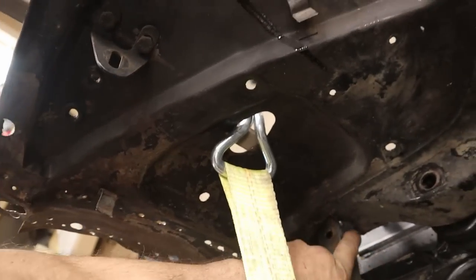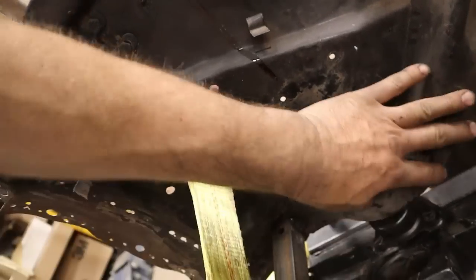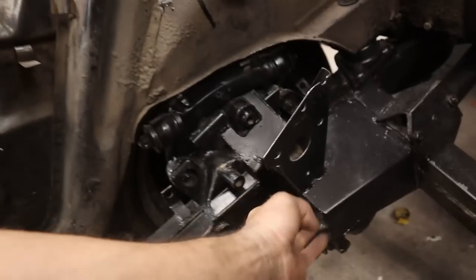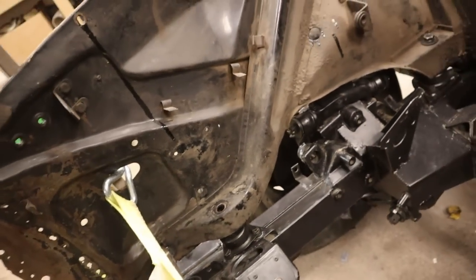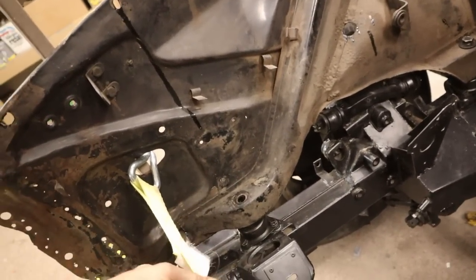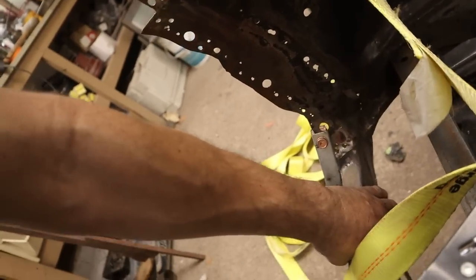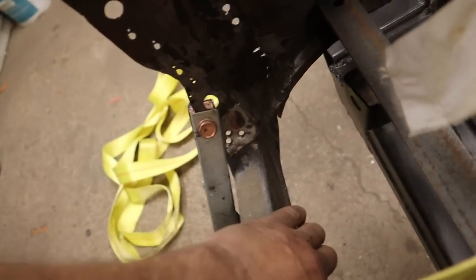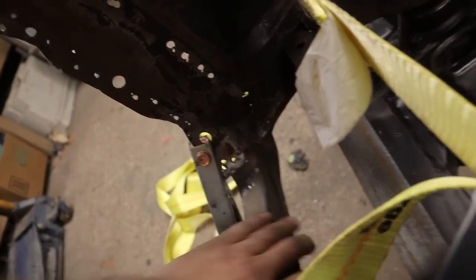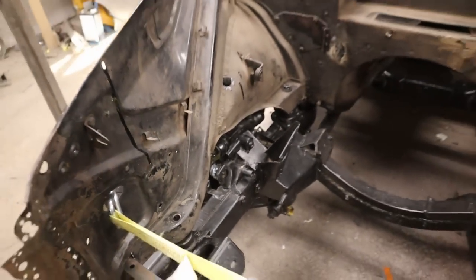Next thing is you have welded that piece of 90 here. So we're going to push on that, and that's going to drag this whole assembly ahead a bit, and we're just going to push against the K-frame here, and it should be fairly straightforward, I'm hoping. It's not the most complicated repair. But the trick again, as you can see, this isn't really that tight, but it's going to help get this all fitted up nice. You can see right away those holes line up that I drilled out there. We're going to be in much better shape than when we got the car. So I'm just going to push on that. I'll get set up and we'll have another look.